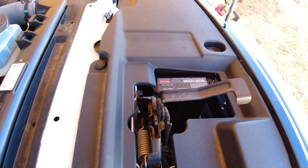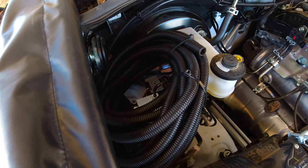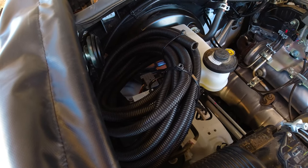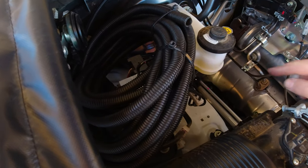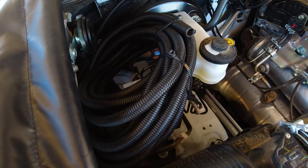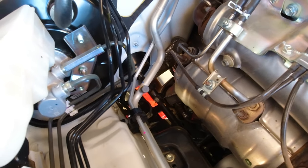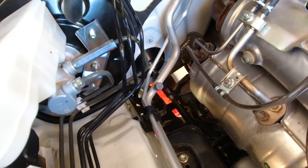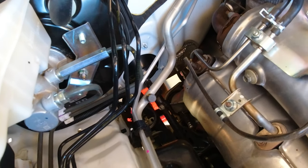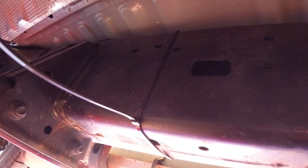When I mounted this DC-DC charger, I left a heap of cabling over here tied up and ready to go. He wants a solar input, so I've just cable tied this, run it down through the car, and put an Anderson plug at the back so you can plug your solar panels straight in and charge his battery while it's stopped. When you're running any wiring alongside the engine, make sure to cable tie at least every 30 centimetres to whatever you can, and try to avoid the steering column or exhaust.